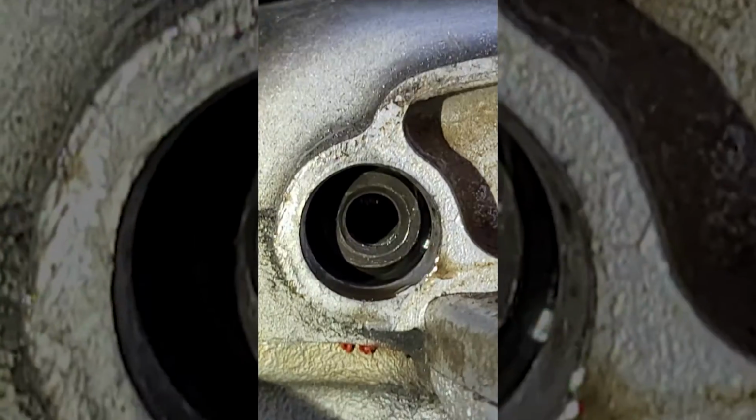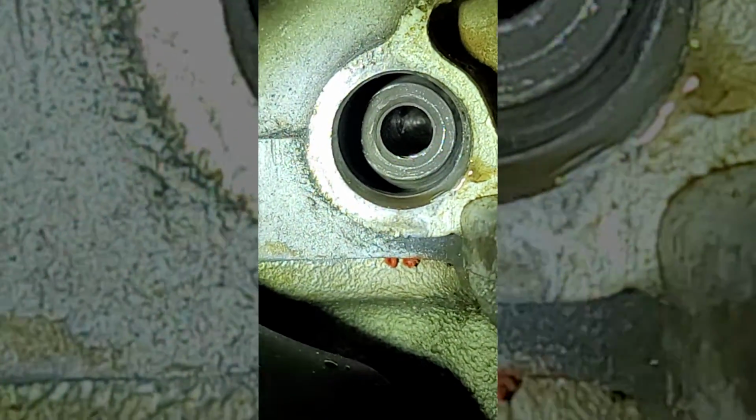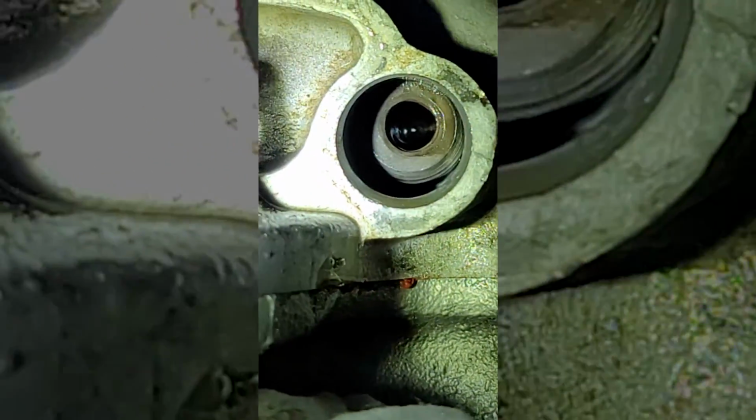At this point, a lot of the problems were solved, but there was still one issue of an annoying ticking sound from the top end, which I worked out to be the infamous one rocker cover issue that 550s can often develop. See, the shafts that the rocker arms rotate on can wear into the engine cover itself and start doing weird things. You see the fact that the shaft on the intake side has a big gap underneath the rocker shaft here. That's how much the shaft has dug upward into the cover. You will see exactly what I'm talking about in a sec.